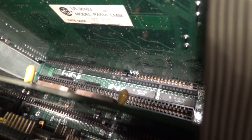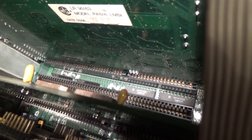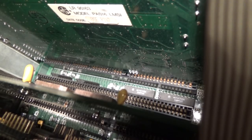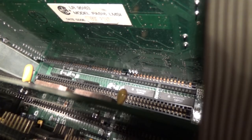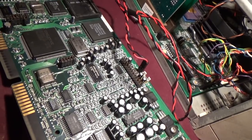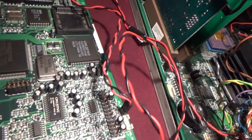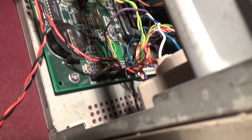How this is achieved is that the PC speaker is driven by a programmable interval timer, which sits on the ISA bus. So MediaVision opted to simply listen at the address this device sits at. This completely eliminates the need for any such cable, and probably eliminates quite a lot of noise as well, as that speaker header usually has quite a lot of noise coming off of it.